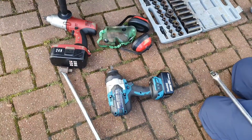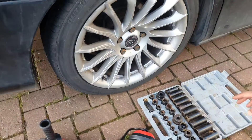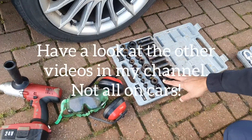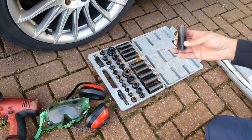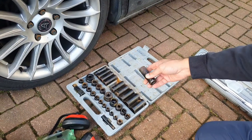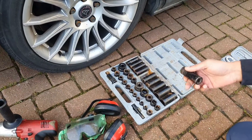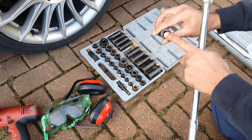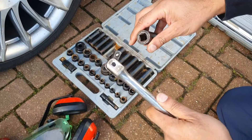The first thing is to identify what you've got here, which is the 19 millimeter wheel nut. We've got these black impact driver sockets which I'm using — they're designed for impacts. I'll be using an impact gun later on, so if you're going to buy one socket set, my suggestion is to go for the hex type with impact ability, so that if you do decide to get an impact driver later on, you can. This is a half-inch size, which fits onto this half-inch square drive.